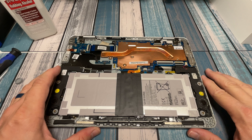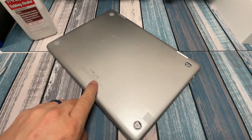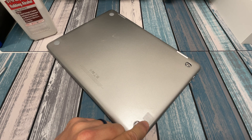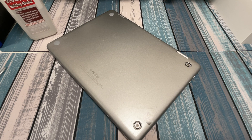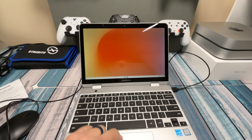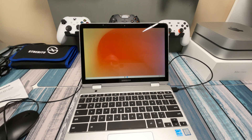Let's put this thing back together and turn it on to make sure it all still works. As I was putting it back together I noticed these little speaker holes right above where those speakers were — this is obviously where whatever that gunk was found its way into the laptop. This is why you don't have open holes on speaker grilles — it's just begging to have liquid poured into it. The good news is I didn't break anything. The bad news is the trackpad still doesn't work, so it must just be defective. Maybe liquid got in there and messed something up, or it's just been abused. The overall condition is pretty decent though.